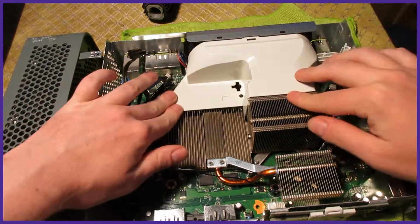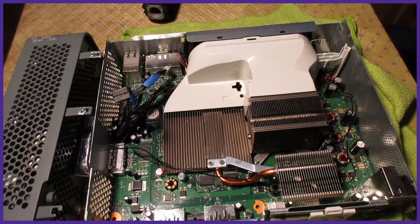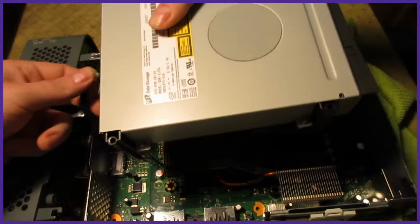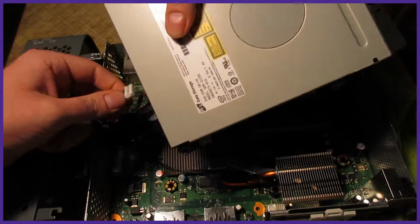Make sure no cables are laying on top of the heat shielding or under the DVD drive, or it won't go back in place completely. If all 4 legs are not sitting on the motherboard, check the sidecar cables. They might be sitting on the plastic heat shielding.